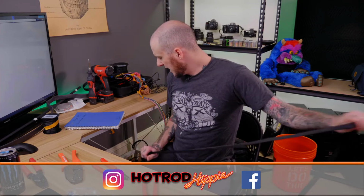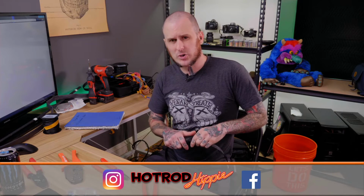What's the deal with fusible links in a harness? Coming from AJ German. Fusible links are generally, let me see if I'm remembering this correctly, generally, a fusible link will allow a longer burn than a fuse will. So say you've got a 15 amp fuse on the circuit, but you've got a 10 amp fusible link in there. The fusible link would allow the circuit to pull 12 amps for 30 seconds before the fusible link would burn out. Whereas the fuse, if you hit 15 amps, it's gonna pop. Or you cross over the 15 amps. That's my general understanding of them.